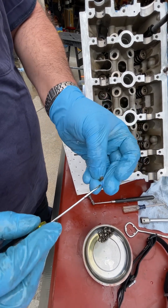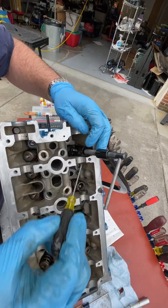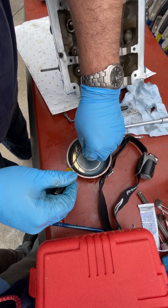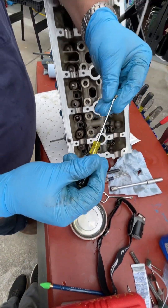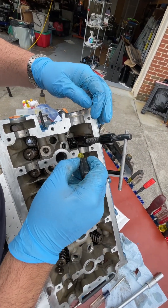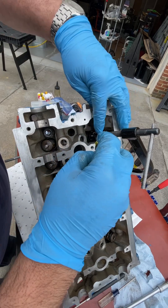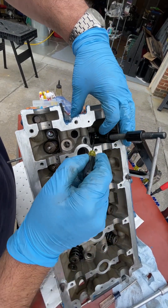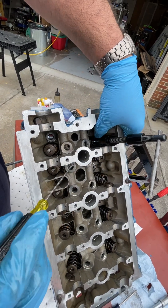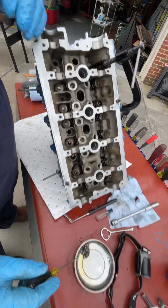The thick side goes to the top. They're sitting in oil — oil acts kind of like a glue. Sit one on a small screwdriver. Every now and then you'll drop one. Get it up on the rings and then slide it around to the back and get the other one.